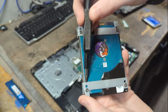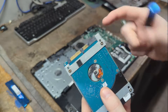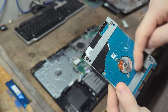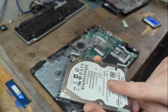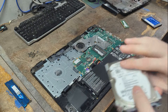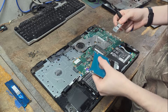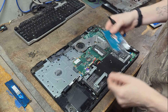With the drive cage, remove the four screws. On some laptops the screws are on the side, and some drive cages are all one piece — if so, you don't have to worry about orientation. A lot of drive cages will have an arrow indicating which way they need to face. As a general rule, keep the label on the SSD facing up. If you can see the bottom of the drive when it's in the laptop, the label should face upward. Keep screws next to the corresponding drive portion, though hard drive screws are typically universal.